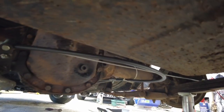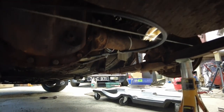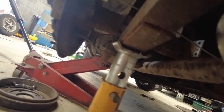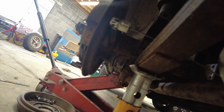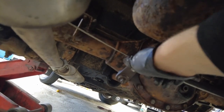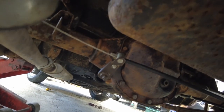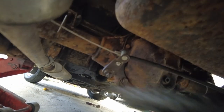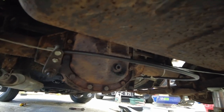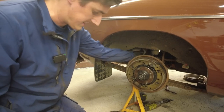Here's our pivot point, and that's where the cable comes in. There are supposed to be spring washers on that - I'll try and get a couple. The cable is routed around there and I put a cable tie around the axle because it was hanging a little bit low. There's a proper P-clip up there and another one in the axle tube which are working fine. Out at the wheel end we have our cables connected - when you pull the cable it pulls both of those cables and moves the pivot over in the other direction.